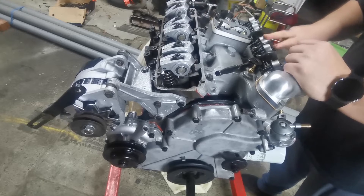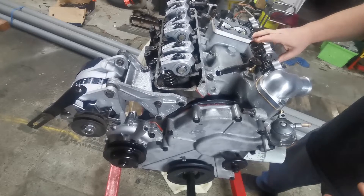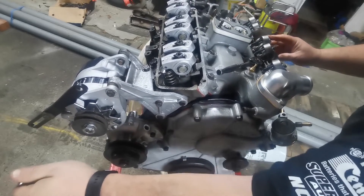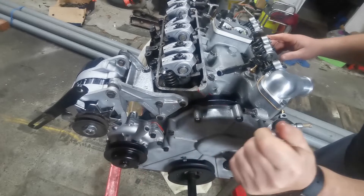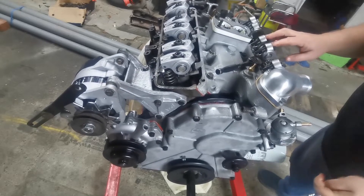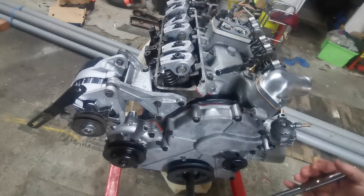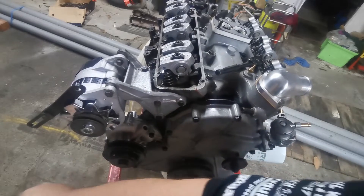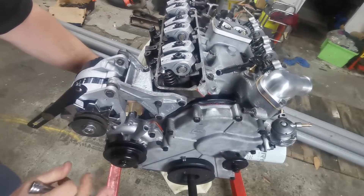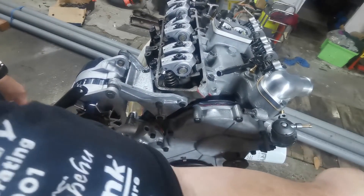One, four, two, five — five is the second rotation. Basically we want to come forwards, and this valve is closing, and that one there is opening — so that's an overlap, which tells you it's firing on number one. The other way to prove that is to go backwards about half a turn, then as you come forwards put your finger in the plug hole for number one cylinder and you should be able to feel the pressure coming up.